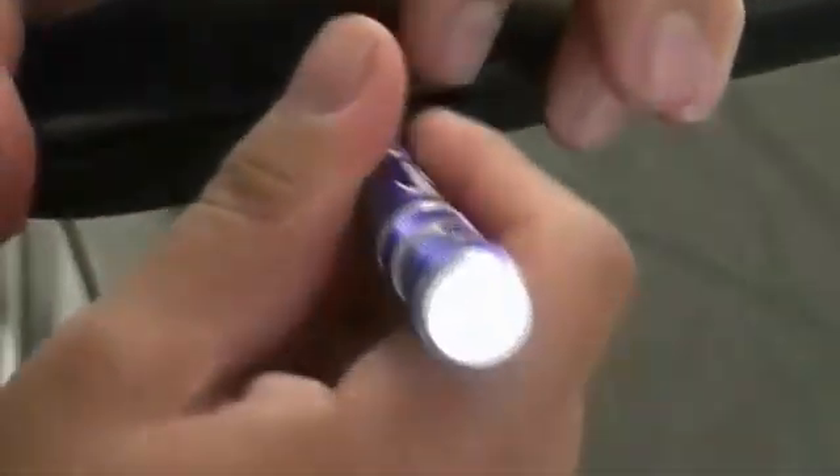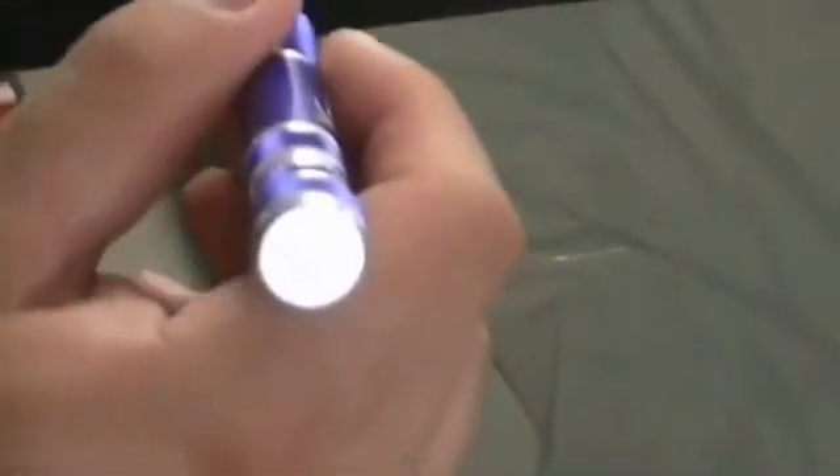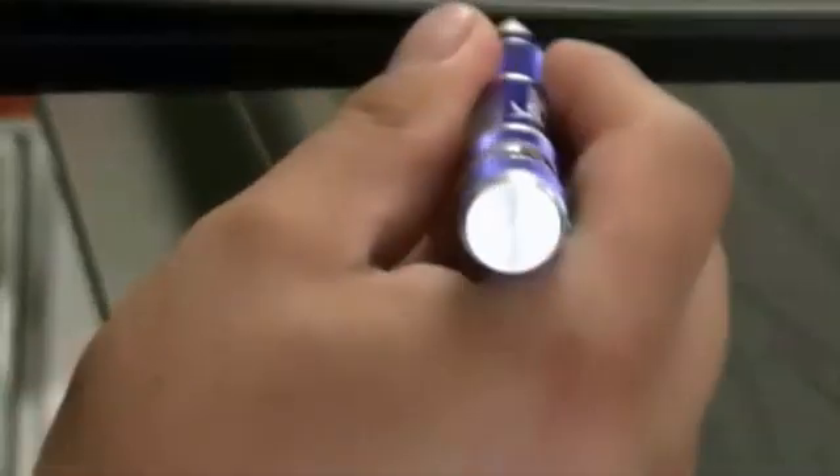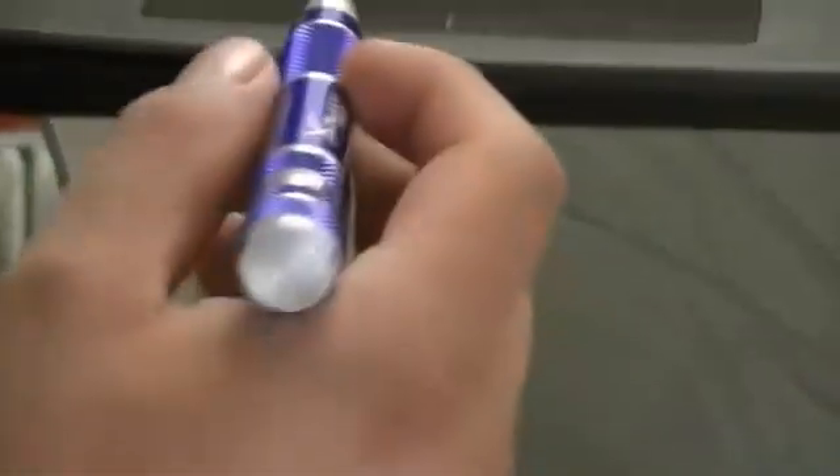You'll just kind of try to pry it as much as you can with your fingernail. If you have a guitar pick you can place it underneath here as well. You're going to do the same thing — just keep on prying. If you hear that little snap, that's because I'm loosening those little clips like I was telling you. You're not being rough at this at all, because you don't want those very plastic-y snaps to break. So you're just going to kind of feel and then push.